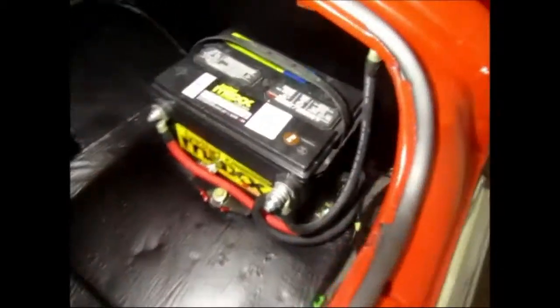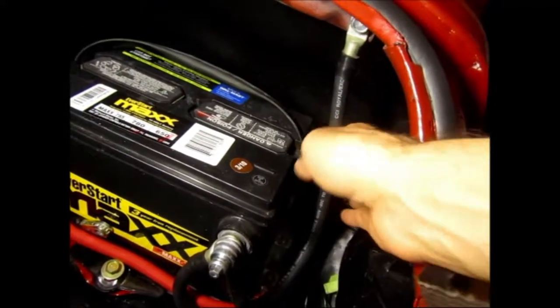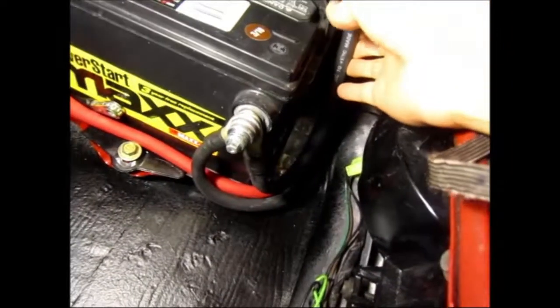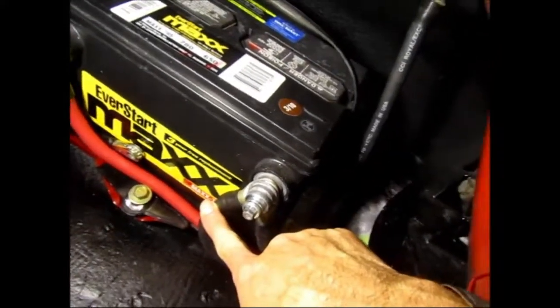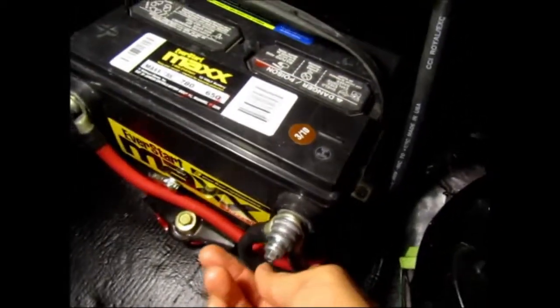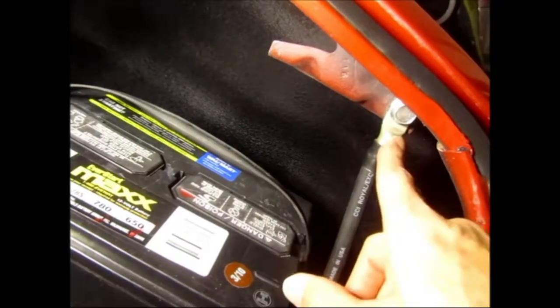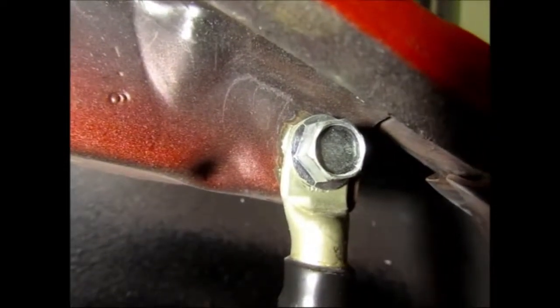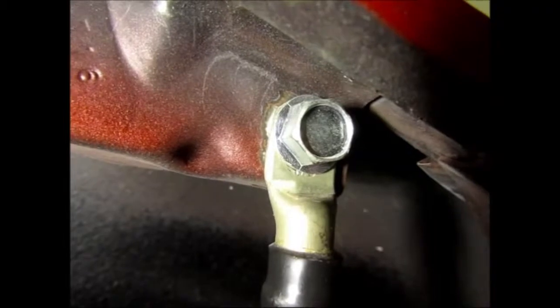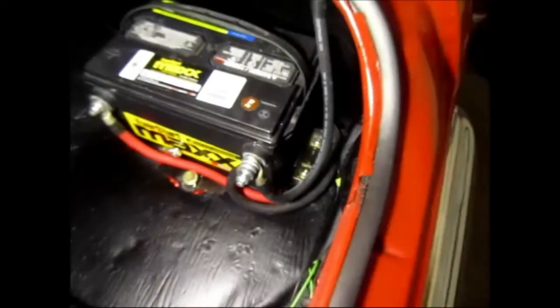Here at my trunk, I still have this battery which I will be upgrading soon, but I did upgrade the grounding for this section. This is chassis ground — it's a 1-0 wire, same as what I use to bring the ground up to the front of the car. I had to use a longer post to get this to work. I used the hole that was already there, sanded down the whole area to make sure I get nice clean steel, and bolted it on with a steel nut — pure metal, no coating — because I want maximum conductivity. That 1-0 serves as chassis ground for the entire shell of the car.